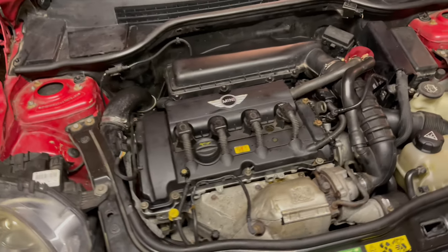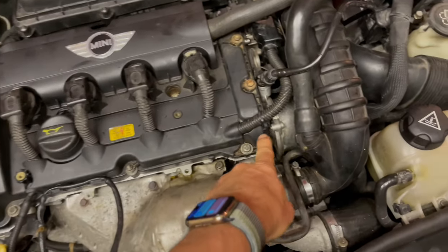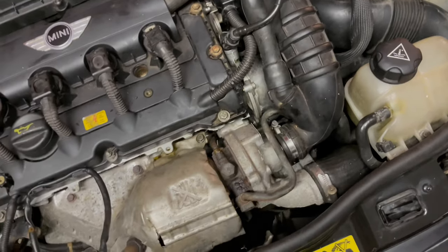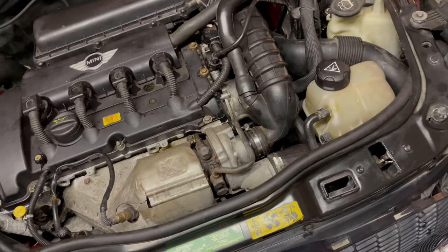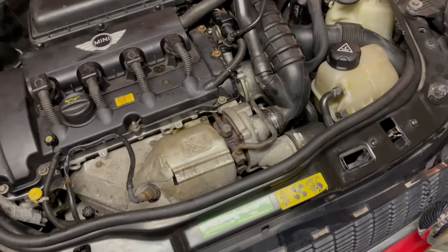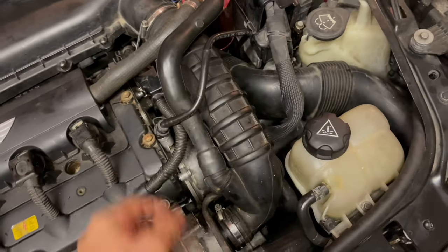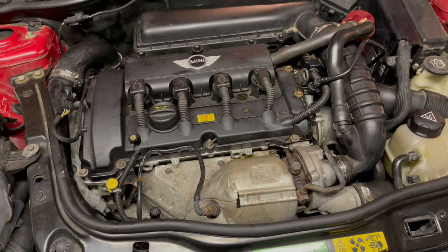Then we assemble — and there we are, all back together again and running. There was a little bit of noise, but it turned out to be the vacuum pump, which is a very common source of a knocking noise from this engine. Took it off — a couple of M8 bolts underneath around there — stripped it down, cleaned it up, checked it was working okay, centralized the housing which seemed to help. Before assembling everything, spread some grease on the flexible joint where it connects to the camshaft, and knocked down the little tab washer on the end. No noises now and it seems to be running okay. Thanks for watching, bye.